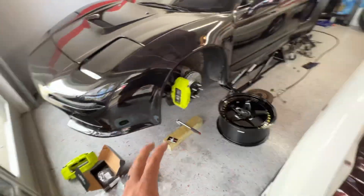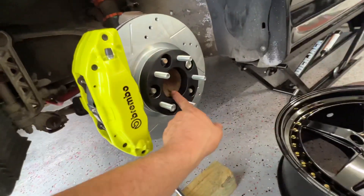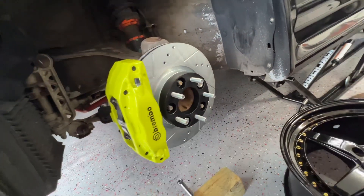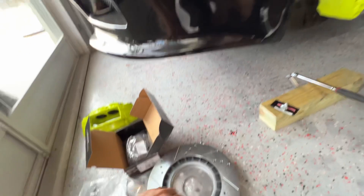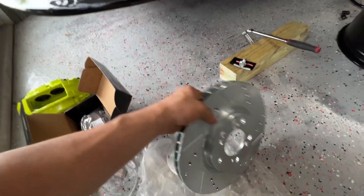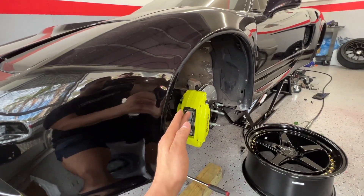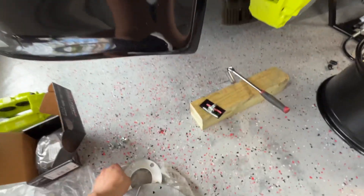With that being said, you're going to be getting rotors. These rotors are made to clear the hub, because the hub on the NSX is a 70.1, so you're going to be getting rotors just for that. And then in order to center the rotor properly within the caliper, we have machined some brackets.